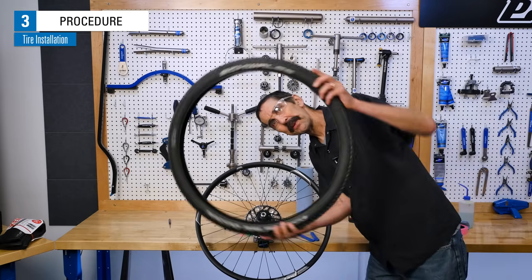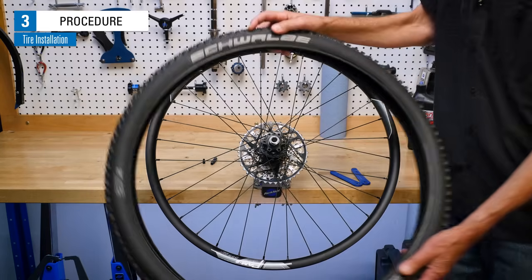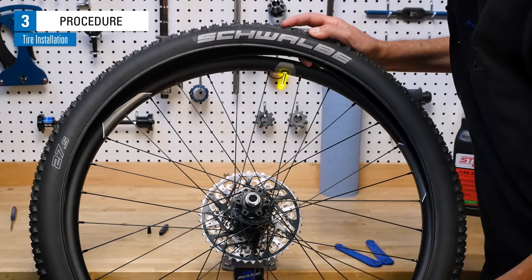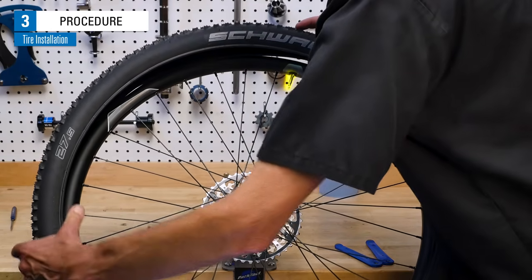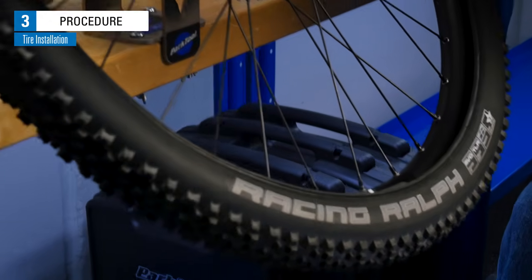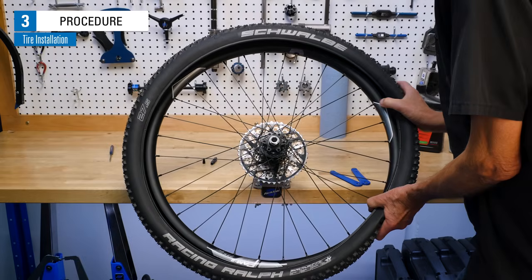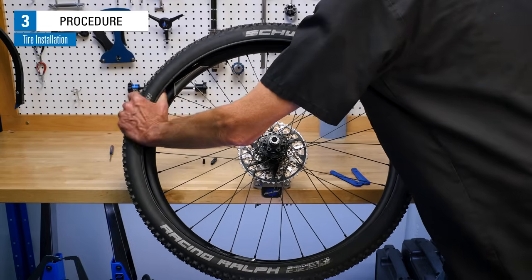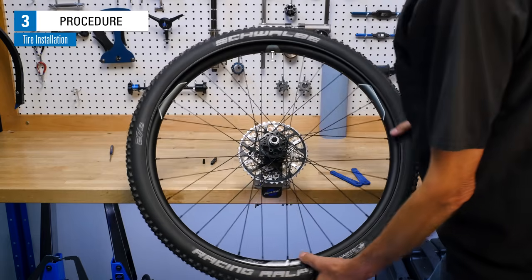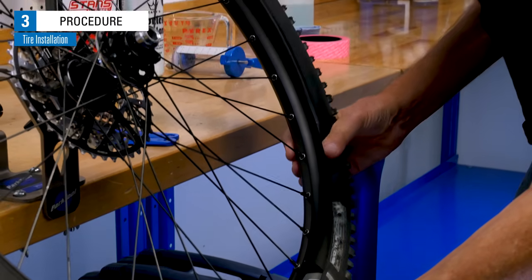Next, we'll install the tire. Mount it according to any directional arrows you find. It's a nice practice to line up the tire pressure label or the logo with the valve — this makes a reference point when diagnosing issues later and you need to take off the tire. Install the first bead starting opposite the valve, pushing the bead into the drop channel of the rim. Keeping the bead in this channel gives you more slack, making the tire easier to get on. Move the bead along towards the valve and pop on this first side. With the first side done, start installing the second bead, again starting opposite the valve.